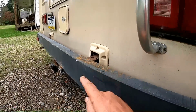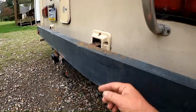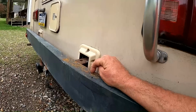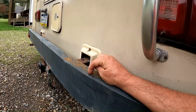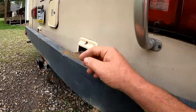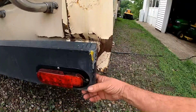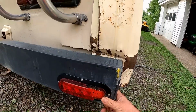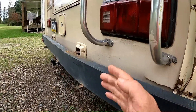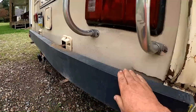This is a C channel, okay? So it's 1/4 inch thick. It comes out, down, and back in. If I slit it, I have to mark it evenly with a square and inscribe a line. If I use a cutoff wheel and cut it back to about a 1/4 inch within this, top and bottom, that'll weaken it to where maybe with a big giant crescent wrench and pry bar or something, we'll be able to just manually pull on it and tweak it into its final position. And then I'll re-weld that slit.